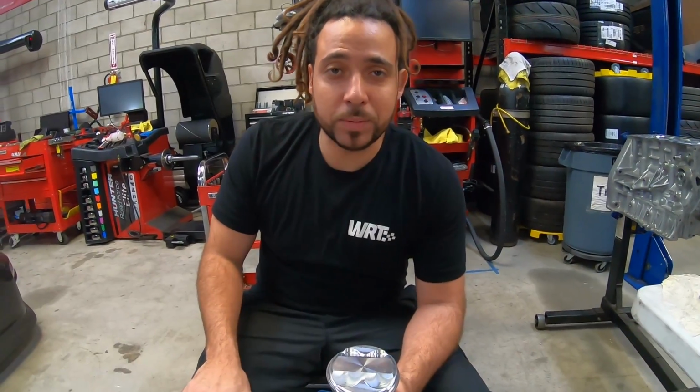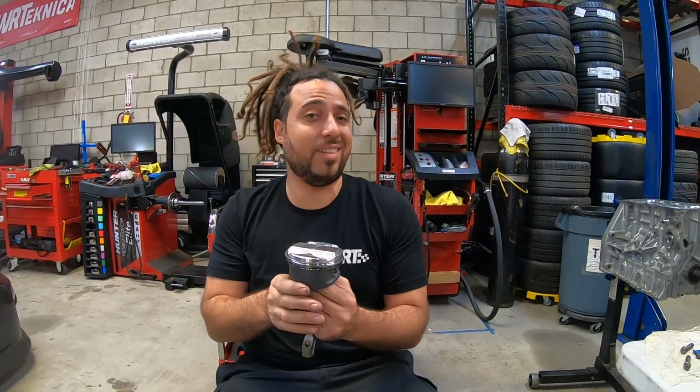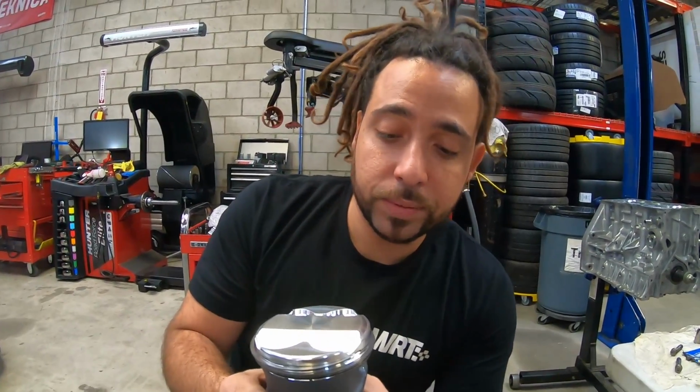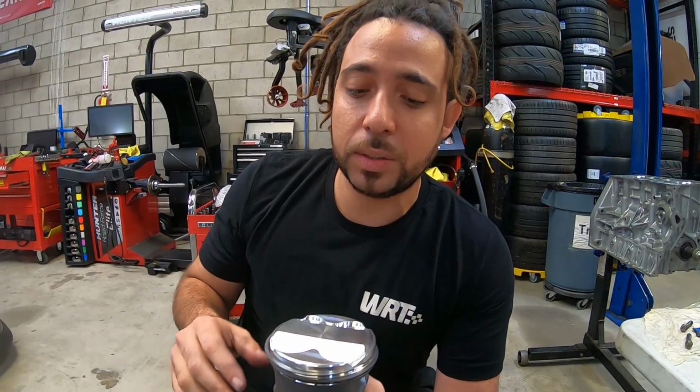All right guys, quick tip. Before you get your piston in your compressor, you're gonna wanna make sure you set your ring gap, first of all, which was done by the machine shop in my case, but also the positioning of your rings. You don't want all 3 ring gaps to be in the same spot, otherwise you're just gonna have a waterfall of oil going right through it. You're gonna burn everything and you're gonna have to tear your motor down again. Usually, there's gonna be a diagram somewhere. In this case, we're using the service manual to tell us exactly where the ring gap is.